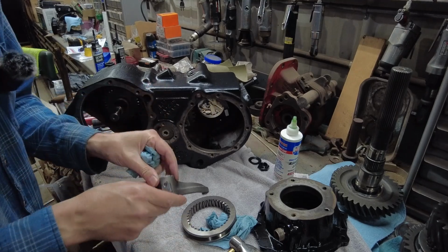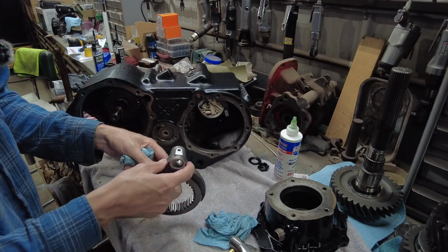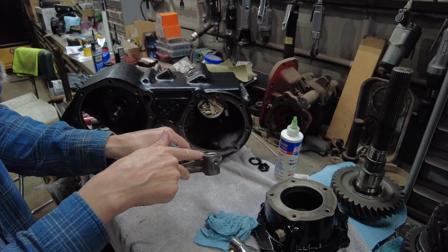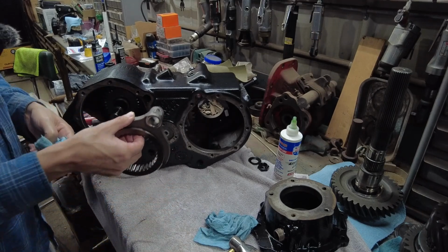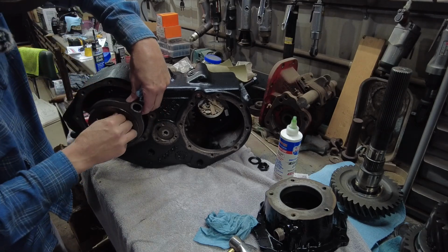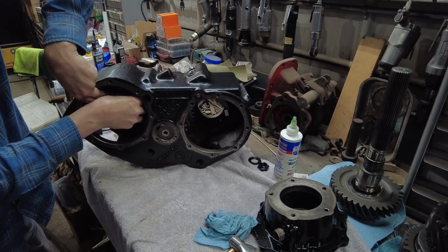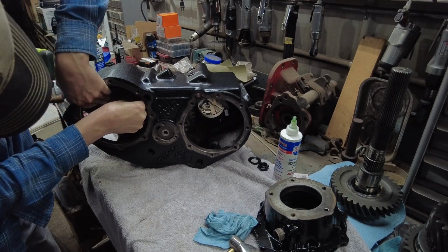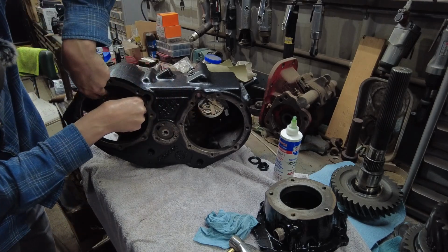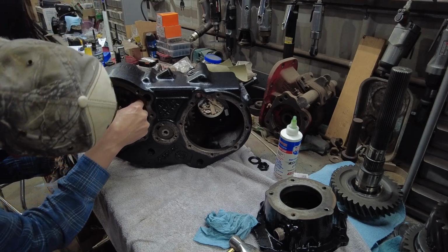Got a new fork. This time you got to put the collar. They call it a sliding clutch. I call it a shift collar, whatever you want to call it. Remember, the roll pin deal, it's the longer side of the shaft goes towards the front of the transfer case. So that's got to go in here like so. And I believe you got to put this stuff together because you can't get this collar on there like the other one. It's got to be put in there together.